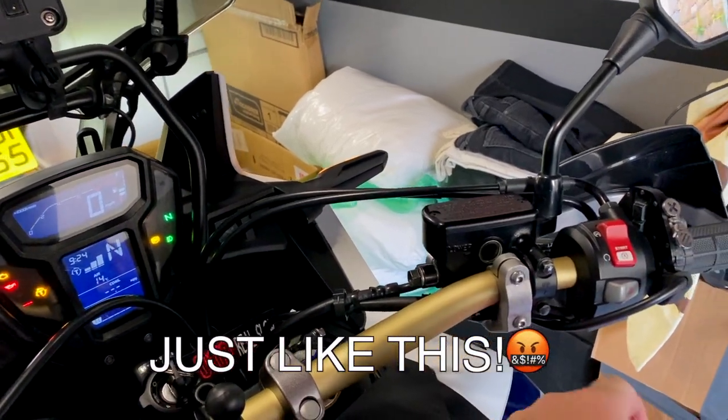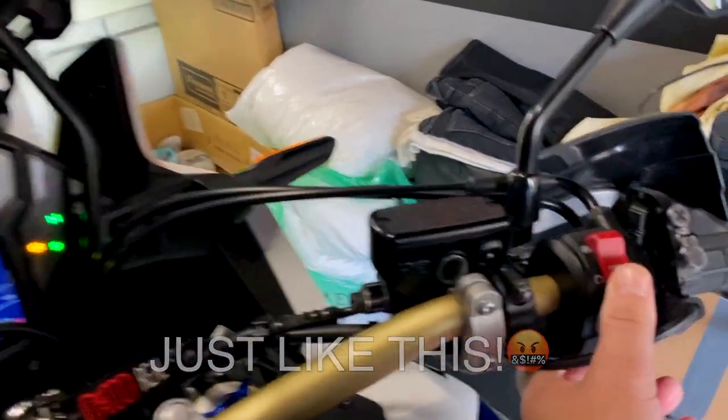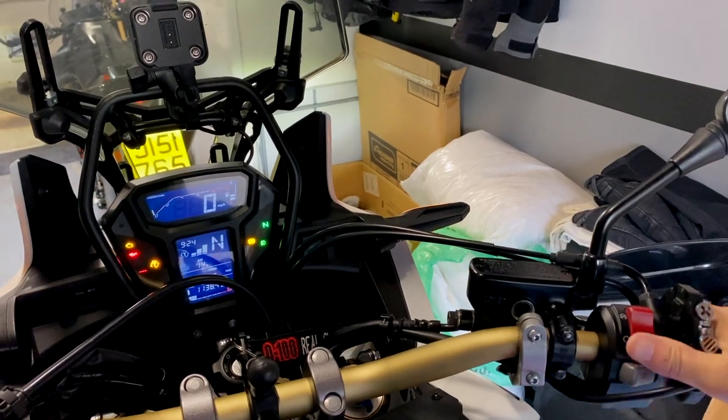Since I've had the bike for two years now, every now and again when I come to start it, it will start very quickly and then stop. A bit of internet research has shown that it's a known problem — this start-stop thing — which is basically caused by some kind of carbon debris on the switch inside the start-stop switch, causing some kind of arcing, which causes the motor not to start. Some people rev it to about 6,000 revs once they've started it to stop the engine stopping.